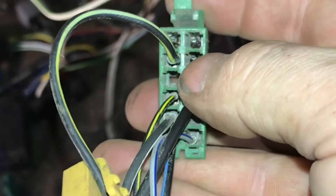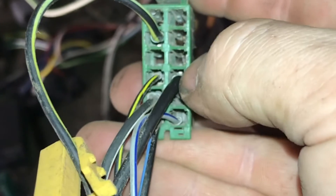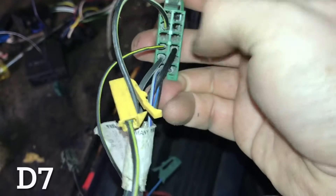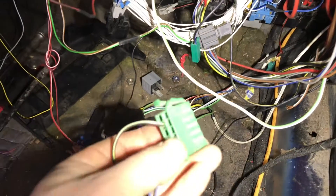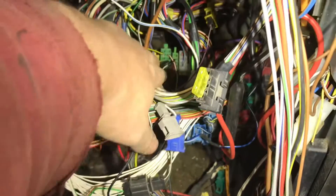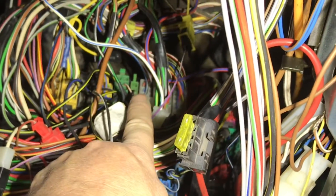D4, D5, D6 are all empty. D7 is my car's auxiliary because it's for ABS. Next is D8 — the big black wire — which is linked D8 to E2, so these two wires just in here are connected together.